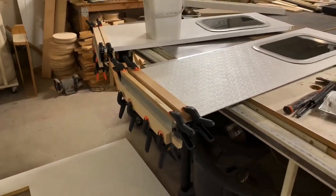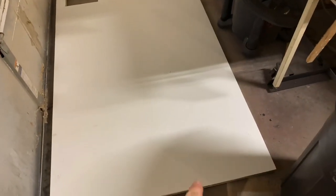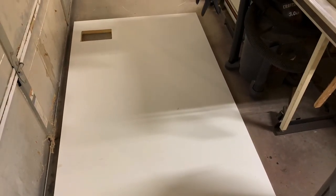Tomorrow I'll let this sit overnight, then I'll get the sidewalls mounted to the floor and the ceiling of the slide-out mounted to the sidewalls. That all has to sit overnight to let the adhesive cure, and I'll run the screws in, but I still want to let the adhesive cure before I move the slide-out around. I want to try to get it installed in the camper in the next couple of days, but I want to make sure everything's fully cured first. The flashing on both walls is glued up — hopefully get the walls and ceiling glued to the floor tomorrow using the same adhesive.